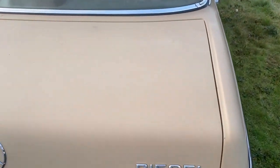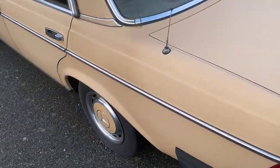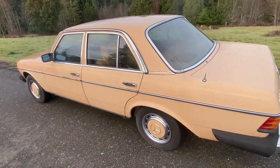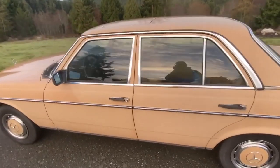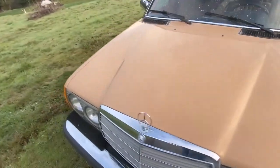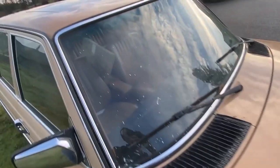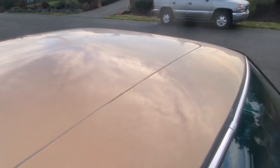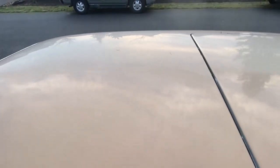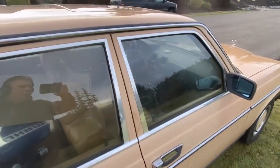You can see the paint here is really faded — it's almost white, faded out bad. However, I took a few minutes to see what the paint might come back like with a little bit of effort. You can see I started working the hood here. It doesn't necessarily come out great, but it's much better. It's more obvious up here on the roof where I did half the roof with just a hand cut, hand polish with Meguiar's. It makes a really big difference, so I think we're going to be able to get a lot of this paint back.